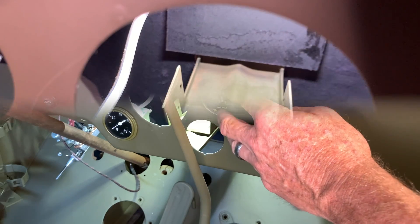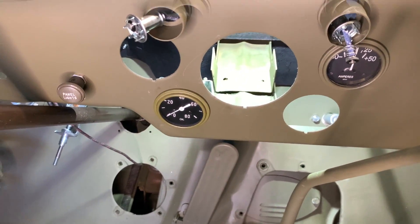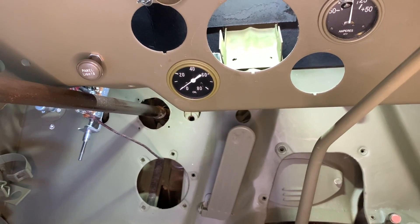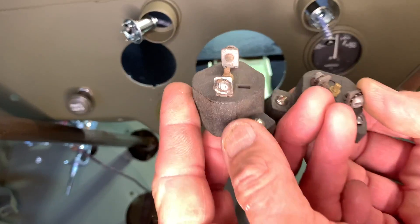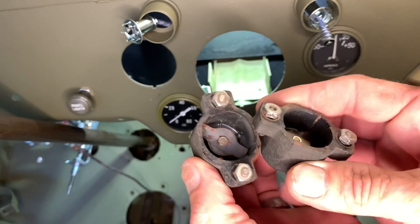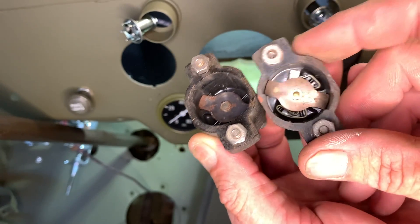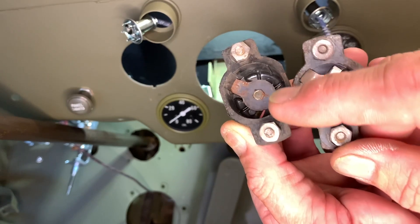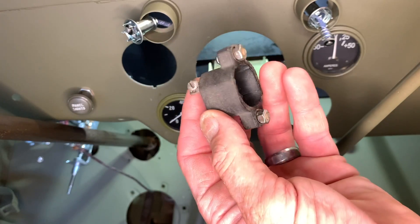Let's move on to the circuit breakers. Through the speedometer hole you'll see a bracket attached to both the firewall and the dashboard, with little ears on each side that have two holes drilled in them. On each one we're going to install a circuit breaker — one for the horn circuit and one for the fuel gauge circuit. I have a 10-amp and a 20-amp circuit breaker available at Ron Fitzpatrick Jeep Parts. The lower 10-amp is for the fuel gauge and the higher 20-amp is for the horn. You can see the lighter elements inside the fuel gauge breaker versus the heavier elements in the horn breaker.